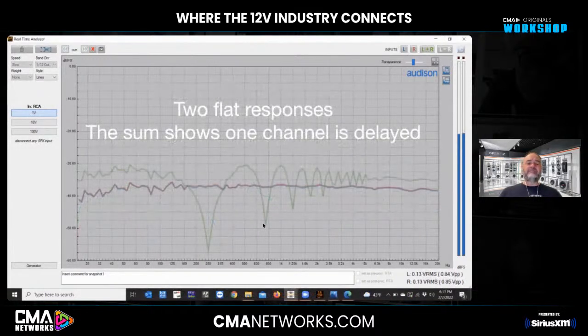So here is an example of delay. I think I showed you the same slide before. This is what you see if delay has been applied from the factory. And we used to be really worried about delay being applied from the factory, and it turns out it's not used very often on left-right imaging applications. If you test the left channel and you test the right channel and they match, and then you test both channels added together and you see this sort of result, check the head unit menu,